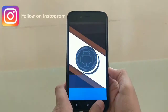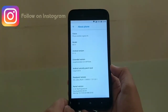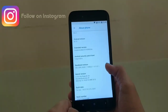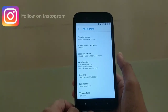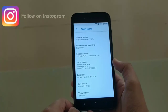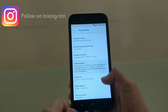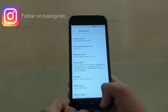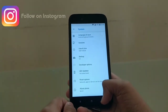Going into About, it shows Android version 8.1.0 with the Oreo biscuit and the octopus easter egg - so yes, running on the latest Android Oreo. The Android security patch level is 5th April 2018. When flashing, you might wonder why I also flashed a kernel - it's because AEX ROM's battery life is not that good by default. I had previously flashed this ROM and wasn't impressed with battery, so I flashed a new kernel that I think can be compared with the Franco kernel.